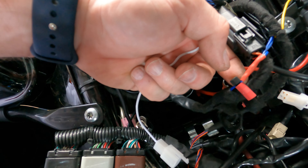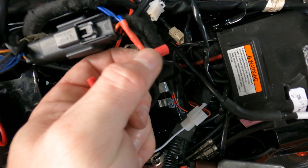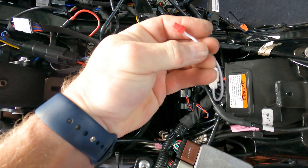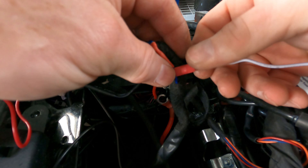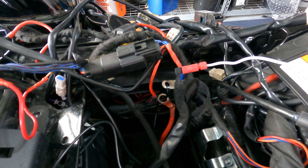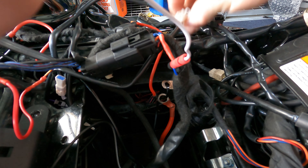After re-soldering that connection, I found the blue wire I needed to tap into — it's the brake line wire, not the reverse. I used a posi-tap: find the wire, put the black piece in there, screw the red one on. Unhook it first to make it easier to tighten down. If you're not sure where the blue brake wire is, it goes into your brake module — just tighten that up and you're good to go.